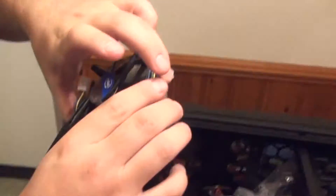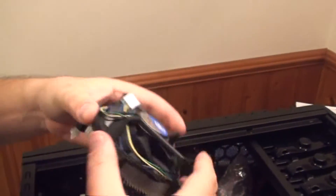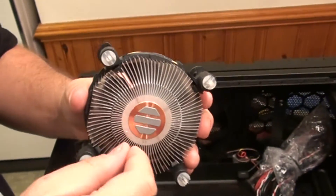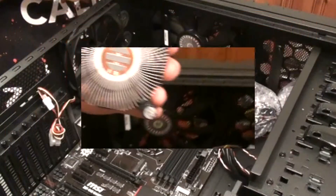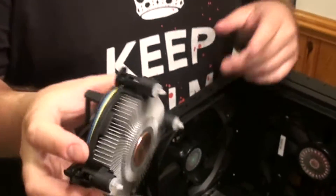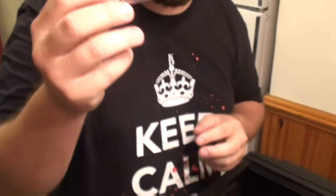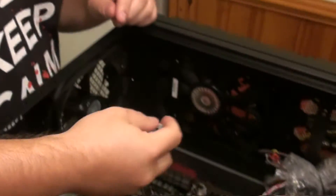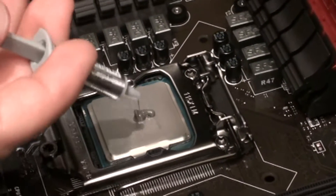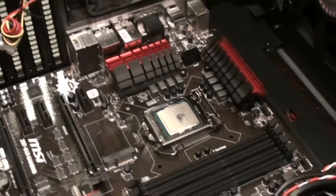Now on all Intel builds here is your cooler. The Intel stock coolers are terrible — they're junk — but since I don't have the water cooling kit yet we're going to make do. You'll see that the cooler comes with thermal paste on the bottom, but that paste is terrible. So give me a couple minutes — I'm going to scrape this off, clean it up, and put my own thermal paste on. All right, so we took the stock cooler, cleaned off the old thermal paste, and now we're going to put Arctic Silver right on top of the chip itself. You want to do about a pea-sized amount, right in the center. There we go — that's all you need.